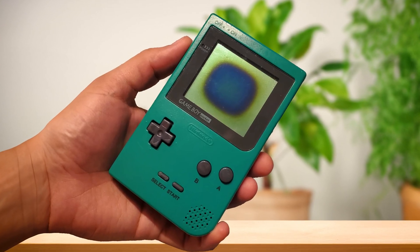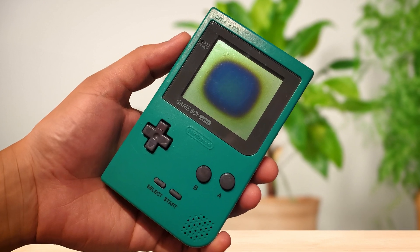And I'm not talking lack of a backlight. An issue that comes up a lot with handhelds from this particular period is screen burn — not to be confused with the screen burn you'd get from leaving the same image on the screen for too long, but this. When I first started seeing screens like this, I was puzzled. Why would so many people be burning their screens with a lighter? Eventually I came to realise that it was actually caused by the degradation of the polarising film and the glue that holds it to the screen. Although some may be lighters.